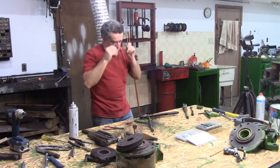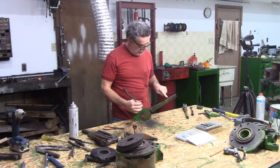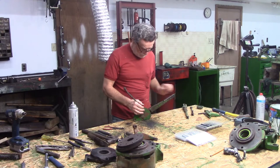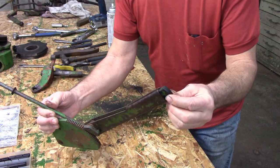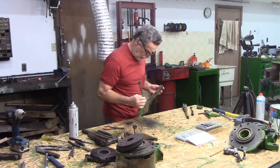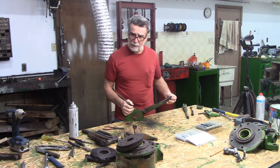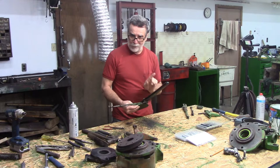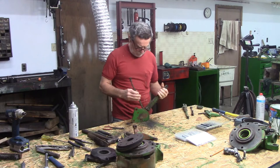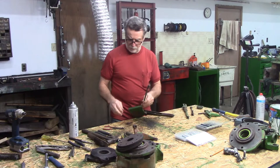I've washed everything up and I just temporarily put it back together and I've been playing with it. I had pulled that knob out on the rod - it's still not attached proper. I'm thinking some epoxy. I've got that slop - you can see probably a quarter inch on that pin. I'm thinking maybe I can make a little bushing or something there, but it is working. Every time I press that little knob, that rod is sliding further inside, so I'm thinking some epoxy there. I'll take it back apart and look at maybe putting a little bushing on there.